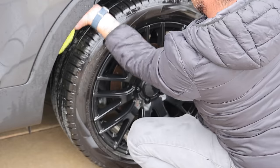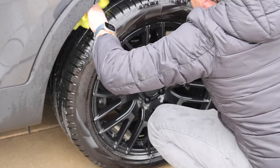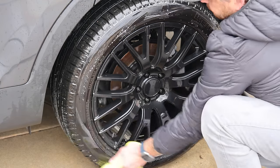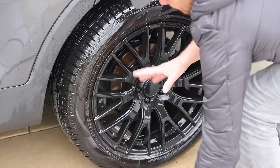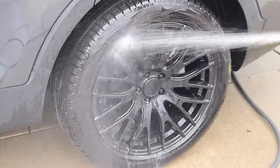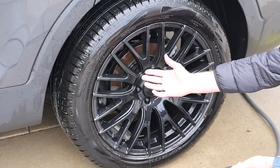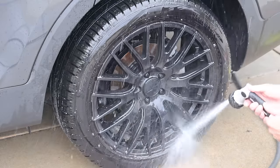Can this introduce scratching into your wheels? Yeah, potentially. I like to use dedicated wheel and tire cleaner with brushes, but we're not doing that today. As for the dirt in the tire — scrubbing with the towel will remove the surface stuff but nothing crazy. We'll also rub out the wheel well with this towel, but once we do that this towel is done — do not reintroduce it to your paint or the wheel. Move on to a new towel because it will be completely saturated with dirt and grime. We didn't get into the barrel of the wheel where a lot of brake dust builds up — specialty tools are needed for that.